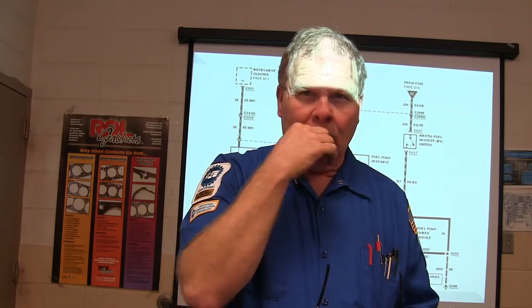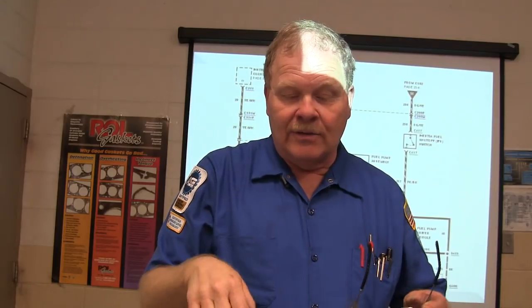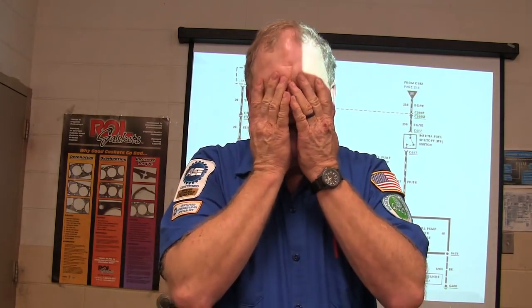You got me? Well, on this one here, on that stalling problem on that car, when I was getting ready to scope the cam and crank sensor, I noticed the bolt in that connector was loose. We're talking finger loose, and the connector was dancing around. You couldn't see it. It looked just fine. But Kayla went and got a 7mm socket. We put that on there, and I cranked on it for many a round before it ever got tight. I can't believe you didn't find that already. It was at another shop before it came here.